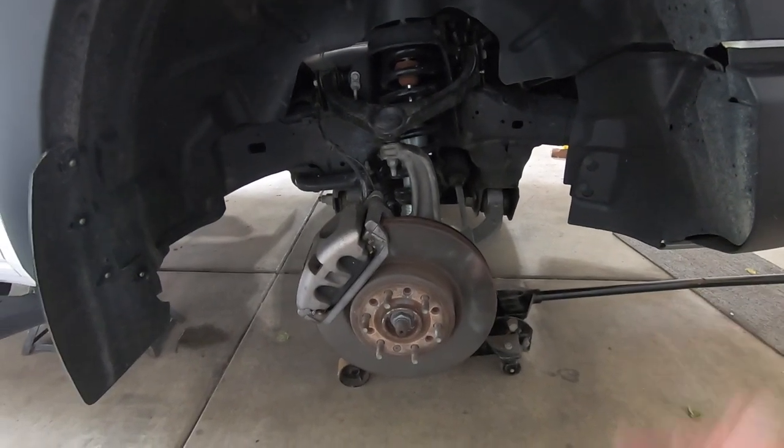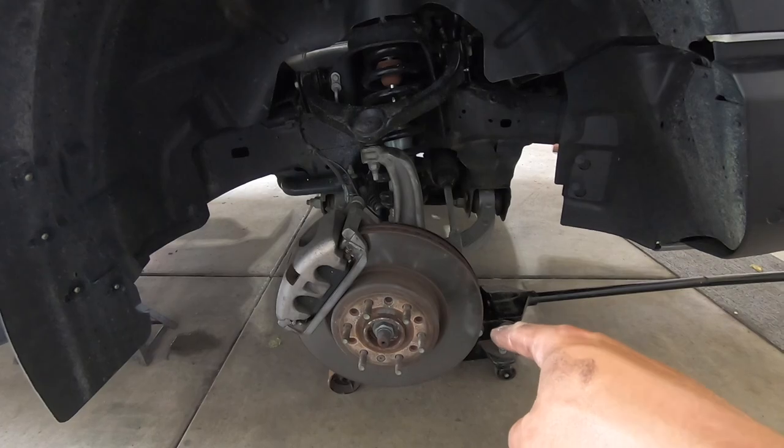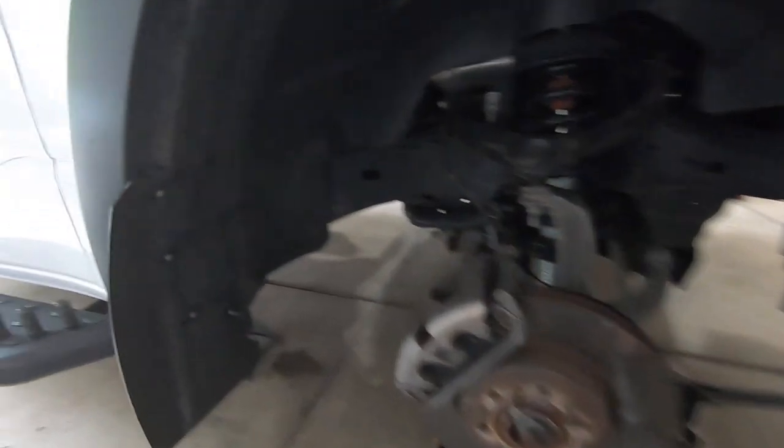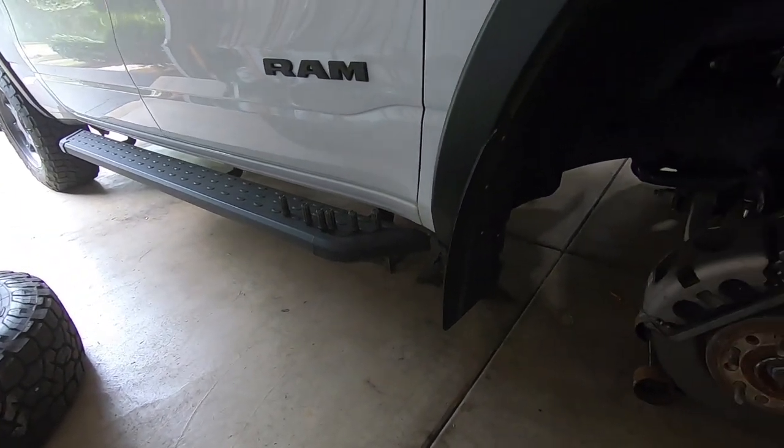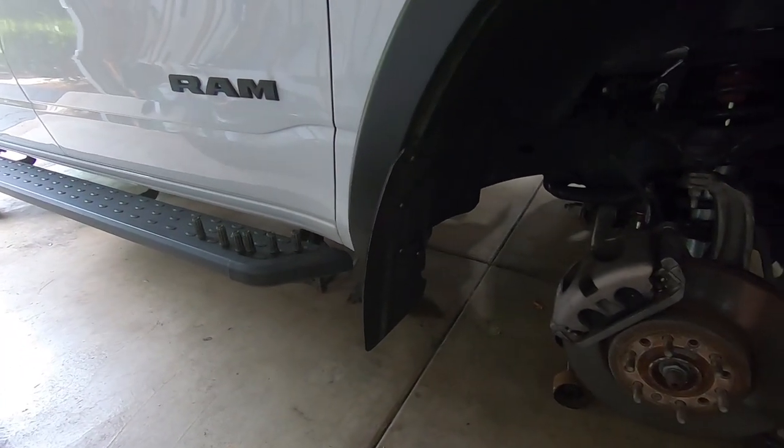Safety first in the Waterfaller 41 garage - make sure that the hydraulic jack is not the only jack holding your truck up once it's up in the air. We got jack stands back there. I always use two per side just to be on the safe side. I love redundancy - I'm an engineer, I love that N plus one.